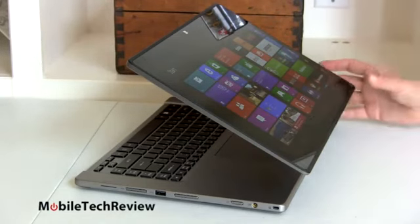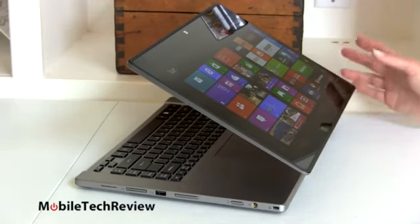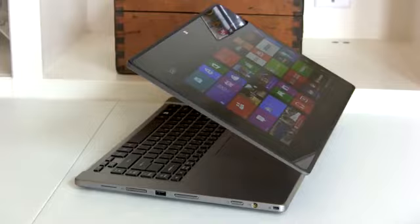In terms of performance, on PC Mark 7, it scored very well. It did 3981. Now that's pretty good for something that has a conventional spinning hard drive. That caching SSD helps only so much when it comes to synthetic benchmarks. So a pretty good performer there. For 3D Mark 11, using the so-called performance setting, which is the middle setting running at 720p, it scored a 646, which is about typical for Intel HD 4000 graphics on the Ivy Bridge architecture.